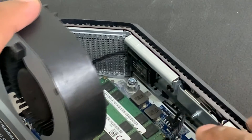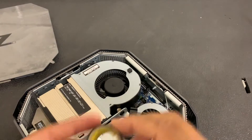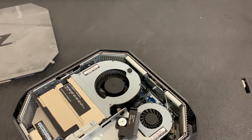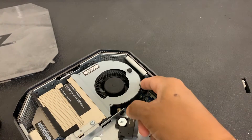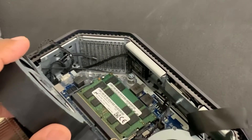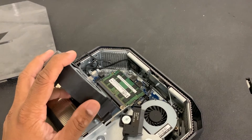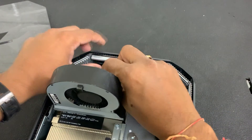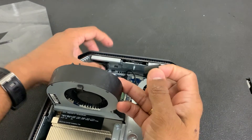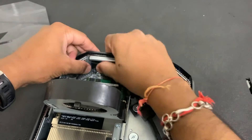What I'm going to do is just get some electrical tape. I'll tape it down so that when you press the front power button it doesn't pop out. I'll take about an inch and a half of electrical tape — there we go. Then I'm going to lift this front fan, plug it in gently, and tape it down gently so it doesn't pop out when you push the front power button. Just take your time, make sure it's secured and all the way in first, then put the tape on. I'll grab another piece of tape to make it more secure.